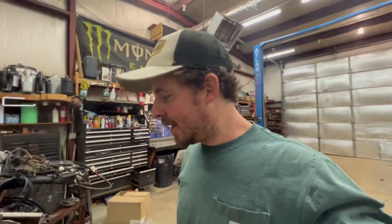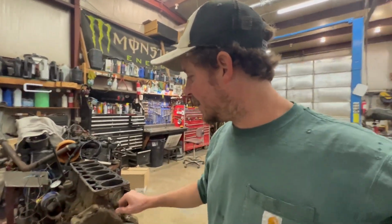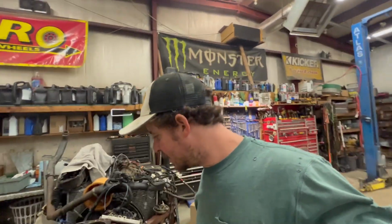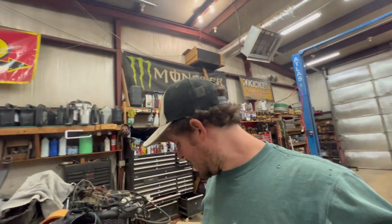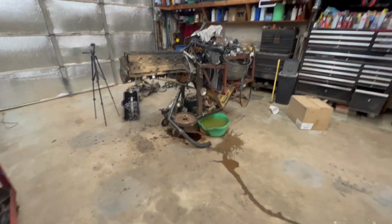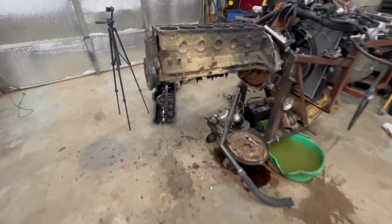Okay, so Justin firmly agreed that the wrist pin should have no slack. So I'm going to clean up some of these gasket surfaces, fix that oil leak, rear main, and we'll hone on this a little bit, see if I can get them looking a little nicer. And then for some reason, somebody's made an absolute mess. So I gotta clean all this mess up.